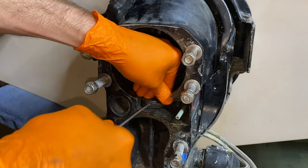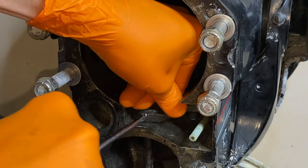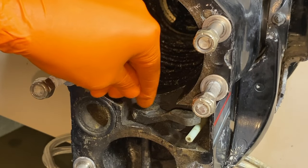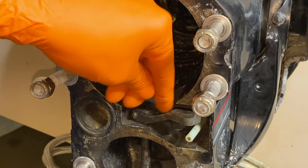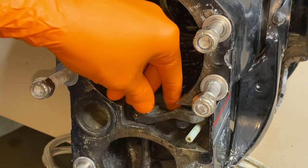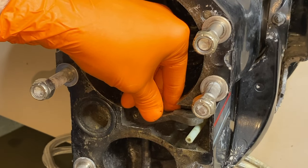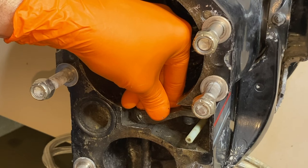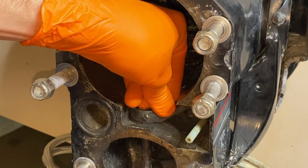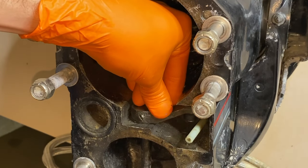The screw is moving — apply some inward pressure as you turn it counterclockwise. Making progress. Here's a quick recap of how this shaft works in relation to the shift cable slide: holding it in the outward position puts the lower slot in forward; moving it inward puts it in neutral; shifting all the way in toward the transom puts the lower slot in reverse. Become familiar with how this works before taking everything apart.